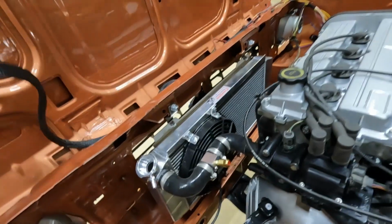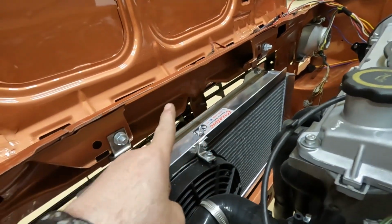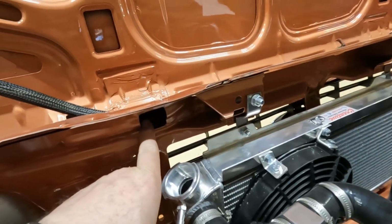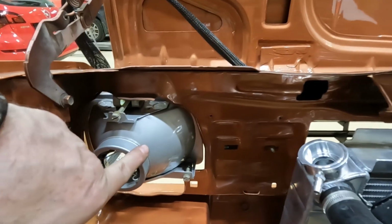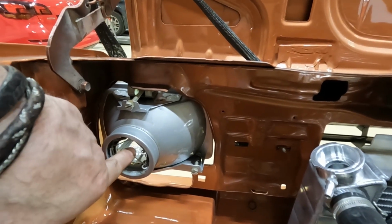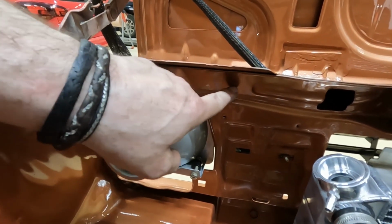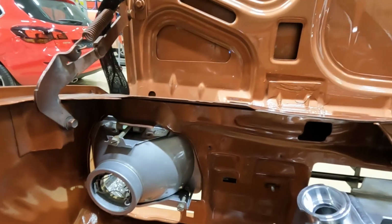Around here I've got the wiring for the lights. My plan with that is I want to get it kind of hidden, so I want to run it through that hole there, along here, through that hole there, into that hole there, and then make another hole here that comes out so that the cable can come out there and go to the headlights and to the indicators there. So I want to make a little hole there, put a grommet and put the cable out there so it just goes there and there, so you don't see it, because at the moment this just hangs.